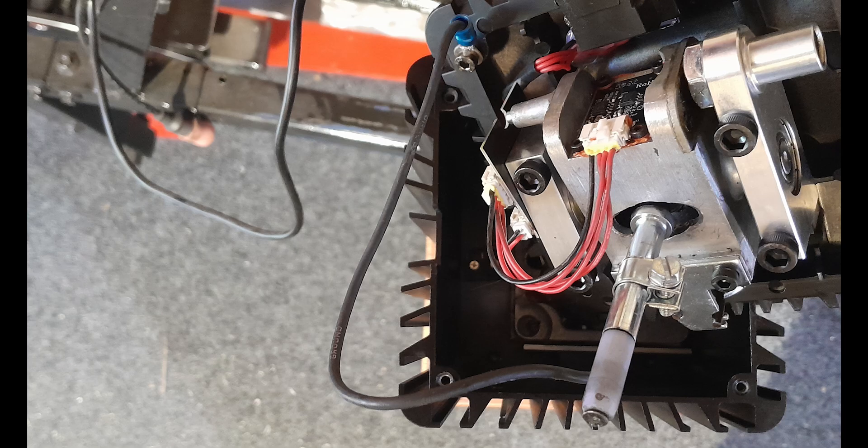What needs to happen to solve this problem is a simple grounding issue. The problem we have with this shifter is that because we're touching it all the time and handling it, we build up static electricity in the shifter itself, which messes with the electronics and messes with the hall sensor. We need to find a way to ground that shifter shaft — where we're holding it.